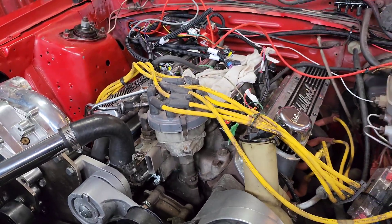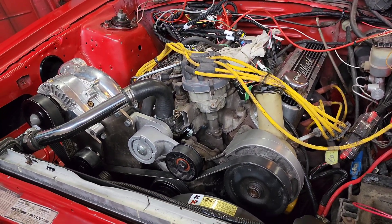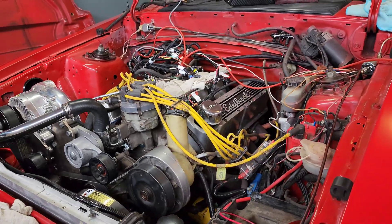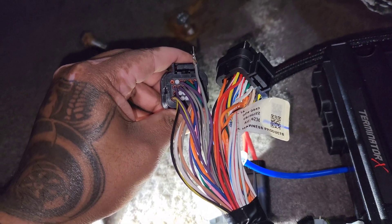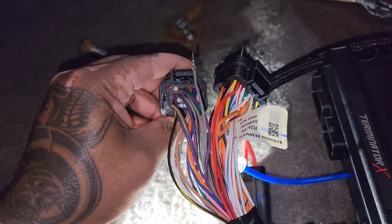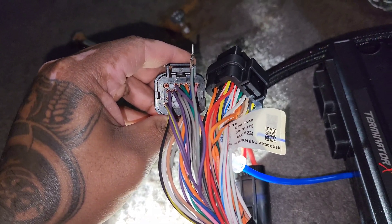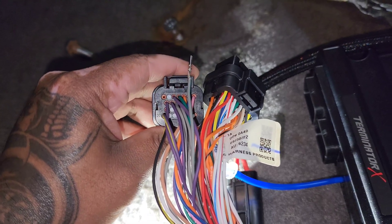The last thing not included is the TFI connector. Now a lot of you guys are running dual sync — this is just my startup situation. I bought most of these parts a couple years ago, minus the 937 kit which was bought recently. One thing I ran into is that I'm running the stock IAC and the Holley is not compatible with the plug because it's specific to a GM plug.